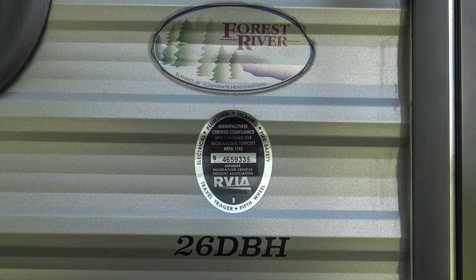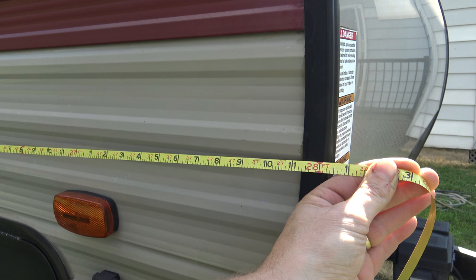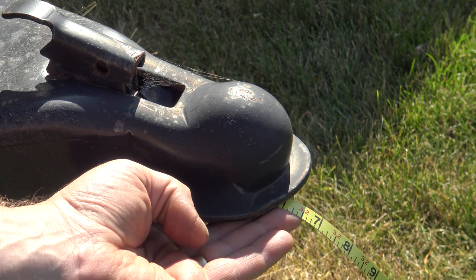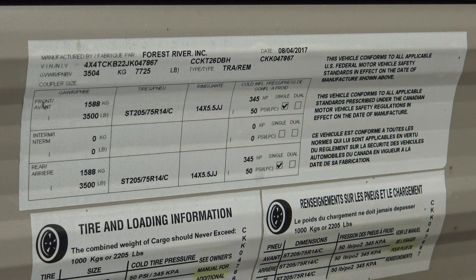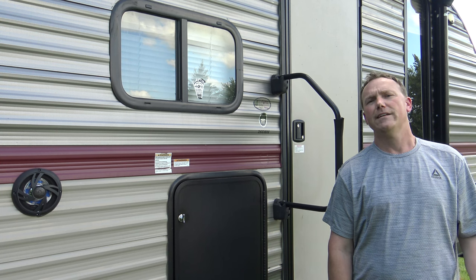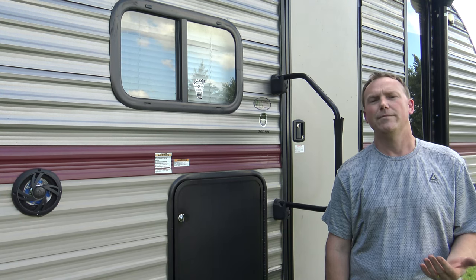It's made by Forest River in Elkhart, Indiana. The exact width of the camper is 8 feet 1 inch. The physical length of just the camper, not including the bumper, is 28 feet and a quarter of an inch. The actual full length from rear bumper to the front of the tongue is 32 feet 7 inches. The dry weight is 5,483 pounds. This one is equipped with a dining room slide-out, and the slide-out dimensions are 30 inches out and exactly 12 feet long. Like most trailers this size, this is a dual axle trailer. So if you're thinking about storing it in a barn or a large garage, you know the full length and the weight, and you can research what type of vehicle you're going to pull it with.